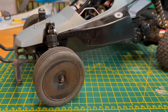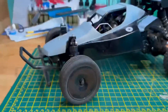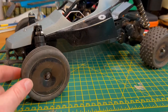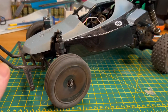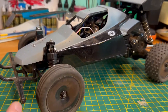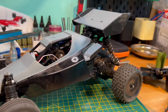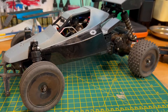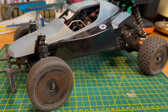I need to sort that out because I can't faff about with the servo - the wheels are now sort of lined up. There's probably a little bit of outward toe, which isn't ideal. If I could get hold of some adjustable arms I might be able to tweak that. The improvements aren't actually going quite as well as I thought they would, and as many people had said to me, you're probably unlikely to get much more performance out of this. So far, that seems to be the case - if anything, I seem to be making it slightly worse.